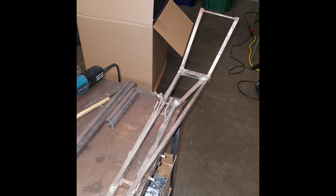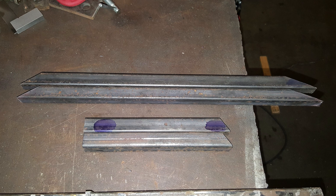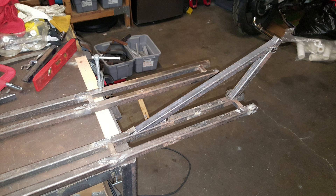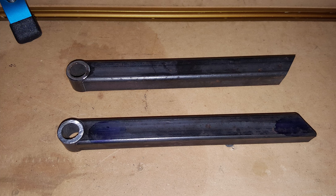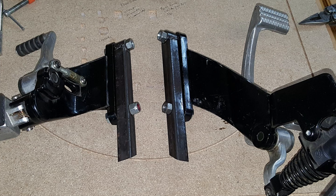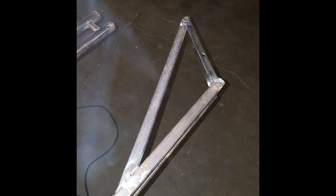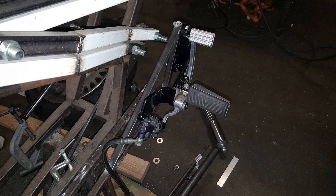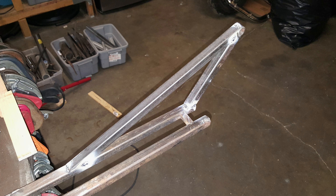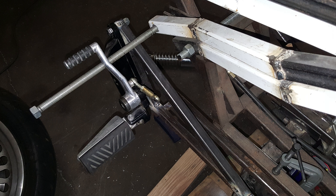To start with, I pulled out the foot rail assemblies and cut off the structure supporting the foot boards and any of the structures supporting the foot controls. I then started on making the mounts that would hold the new foot controls. I notched the end of these with an end mill so I could insert a tube in there that the foot control would mount to, put those tubes in, and then welded them in place. I used the foot controls themselves as a quick template to find and locate where the other hole would be, drilled that out, and then clamped it onto the foot rails before welding it and rigging it up with the actual foot controls in the bike. I repeated the process for the foot controls on the left side, welded those, mounted the left foot controls onto the new foot rails, and then put them in the bike to see how it all looked. With both foot controls in, it's looking pretty good.